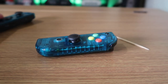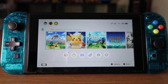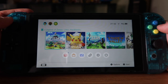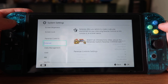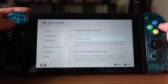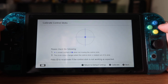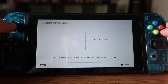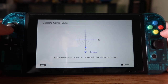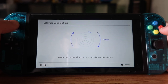Then we're going to leave it to dry for about five minutes. Once you've cleaned your Joy-Con and feel that it's dry, go to your system settings — go down to Controllers and Sensors, then Calibrate Control Sticks. Press the left stick and then hit X to calibrate. Match it up with the line, let it fling back, then release and rotate.